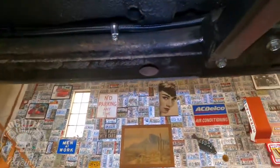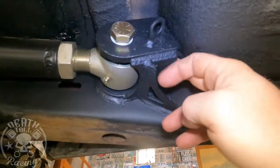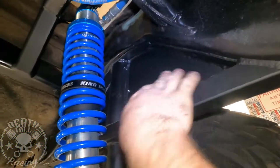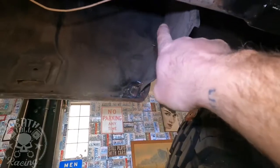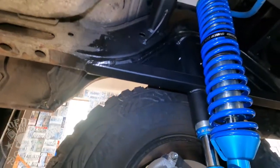And then I have it clamped to the floor, and this is where it'll start clamping to the frame, and it'll be frame clamped the rest of the way until it gets to the fuel tank where it goes back to body. And it wraps up and around the frame there. Because this control arm's in the way, I can't stay on this side, so it's on top of the frame, and then it comes out on this side right here. So we have the return line and then the pressure line, and then my fuel pump is going to be mounted right on this flat surface here, which is kind of nice because it's recessed because of the tube. So it'll mount there. There's going to be a post-filter probably right here, and then we'll have a pre-filter on the inlet side. It may be up here next to the fuel tank coming down if there's room, which I'm not sure there is. The fuel lines will be coming through this gap here. So yeah, it gets kind of crazy with this stuff. So let's just get to it.